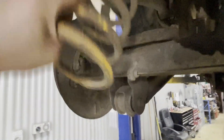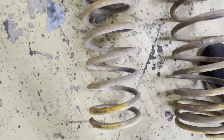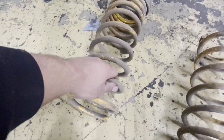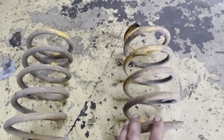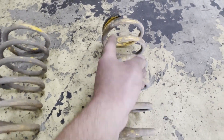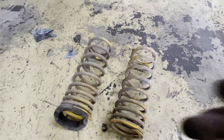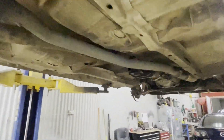One spring out, and there's the other spring out. One spring was actually the wrong way around anyway — it came out from the top, but it's meant to be sitting on the bottom, so that's where they sit in the seating area. These are load springs. I'm going to start with one full coil — as it goes around I'm going to cut it off here, one coil. See how it rides, and if I do want to go lower I can always take them back out. Pretty easy job.